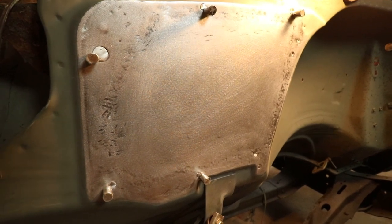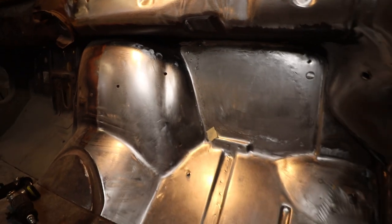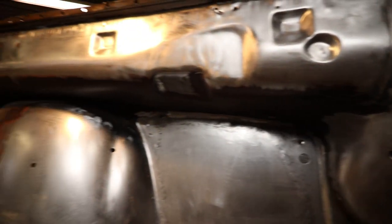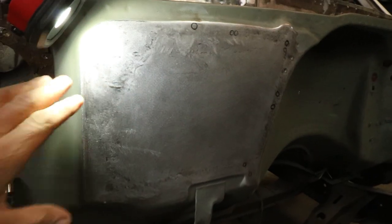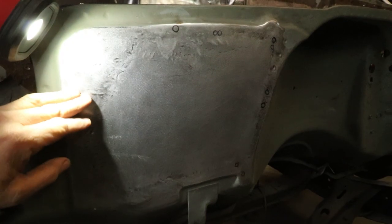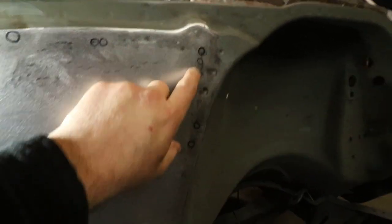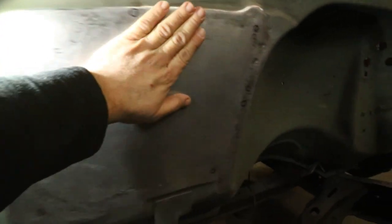It's the next morning — let me show you what I did last night. I cleaned up all this again. I also made these plugs for all the holes that are unnecessary now, so I'm just gonna zap these in and that will take care of that. On the inside I cleaned up as much as I could and sanded it down with 80 grit. I got all those holes filled and metalworked the area with my dad. What I'm doing here is I turned off the lights and I'm looking for small pinholes with backlight on the other side. I found a couple, plus two that you could only see when the light was on this side looking from the inside out. I'm gonna weld those from the other side, and then we can slap our all-metal or fiberglass filler in there to seal that seam.